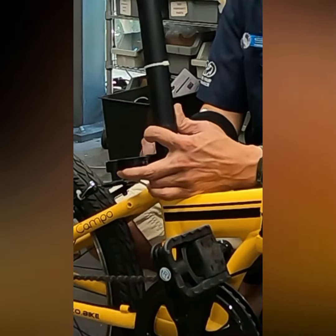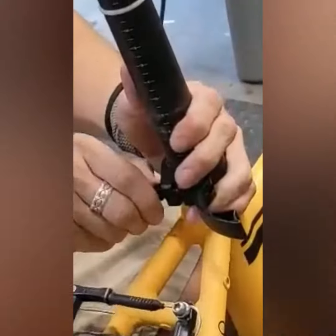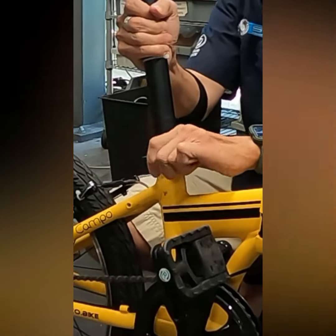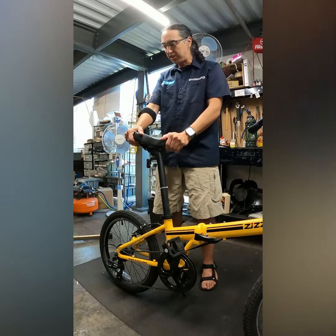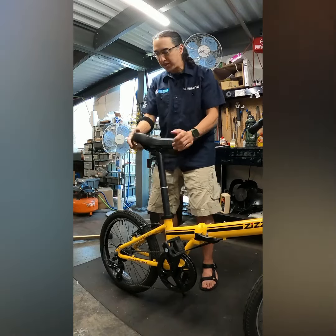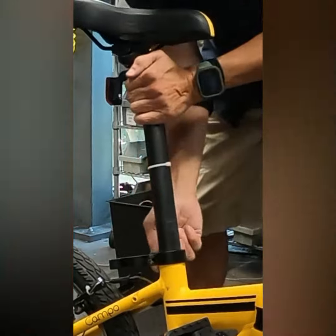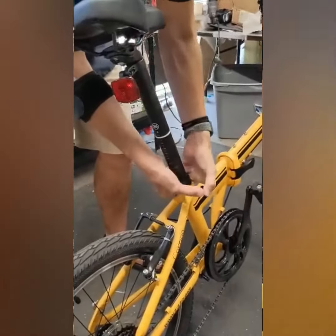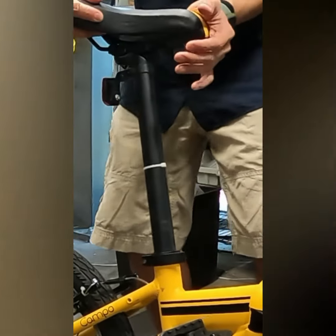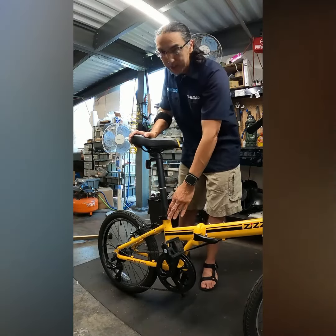You can see I'm turning it much more easily with my hand. When the quick release lever is open, give it a good half turn to a whole turn, and then close the quick release again. To test whether your saddle is securely tightened, just give it a little twist. If it still moves, open the quick release again, give it another half to whole turn, close it, and test by trying to rotate. If you can't twist it anymore, that's your indicator that the quick release is sufficiently tight.